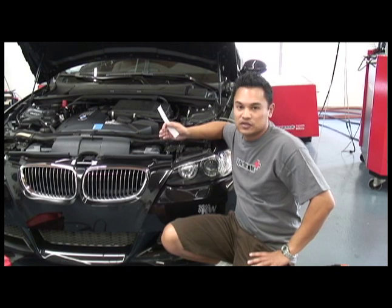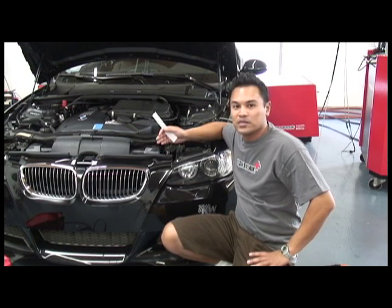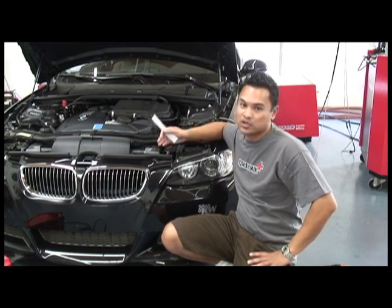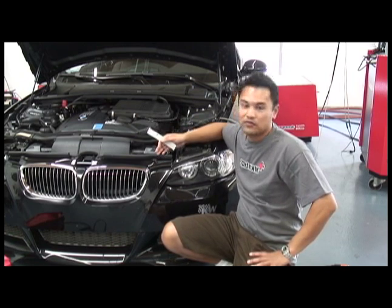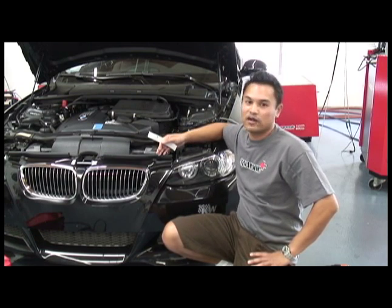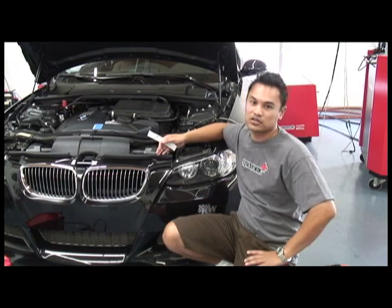Well, there's actually a lot of cases where you don't need to stick a filter on your blow-off valve, because it's never going to suck in air at idle or cruising on the freeway. What we're going to show is on this 335, the turbo is actually efficient enough that at idle and cruising on the freeway under high vacuum, it's actually blowing air straight out the open blow-off valve. So there is no airflow going in the other direction to be able to suck particles into the motor.